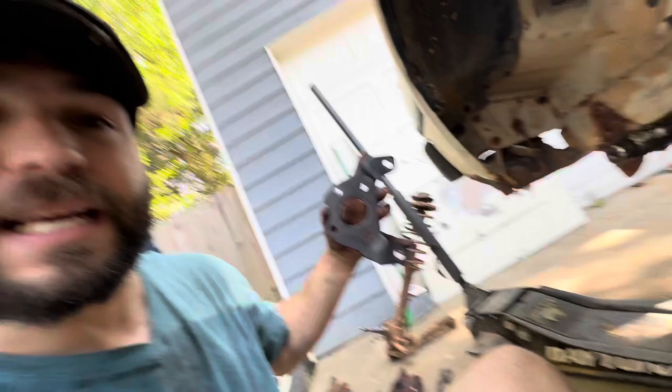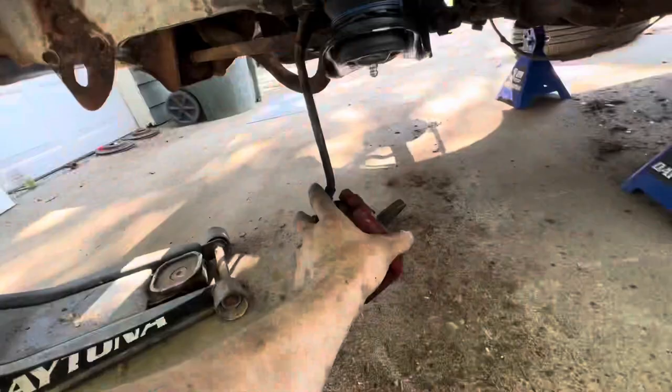And well, the spacing from here to here is not far enough apart for these TE72 calipers. Now, the cool fix for that would be just AE86 brakes. Well, front calipers, they're not easy to come by. You can get them, I'm not going to be able to find one today. So that's not going to work.